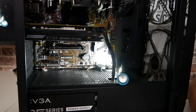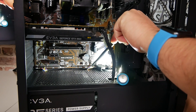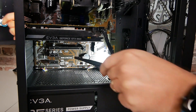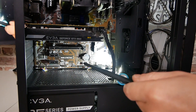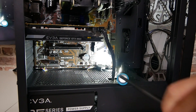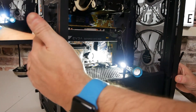We need to find which ports we actually need. We need our USB connection for the Bluetooth — looking along the bottom section, I'll use one of the antennas to point. You can see the USB header there — we've got one plugged in for front USBs, and luckily there's a spare one for the Bluetooth module. For our PCIe slots, we've got a couple available — we could use the 16-times slot or either of the two bottom ones. I'll go with the very bottom one to keep it further away from the graphics card.